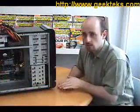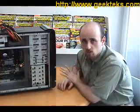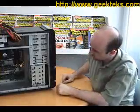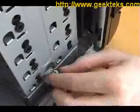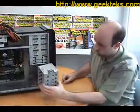One of the things I really like about this case is this removable hard drive cage, which lets you install the hard drives without having to muck around inside the case with a screwdriver. To remove it, we'll just unscrew a screw here like that, push down on this lever, and pull out the cage.